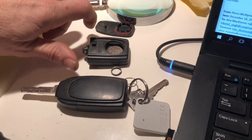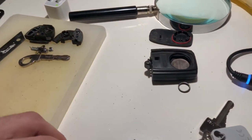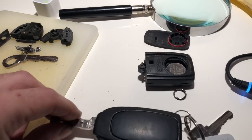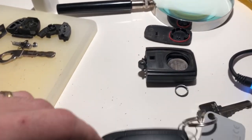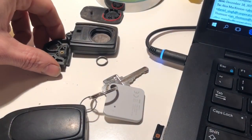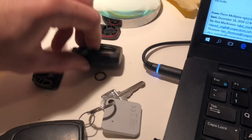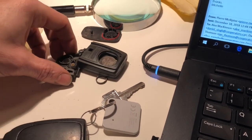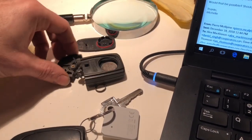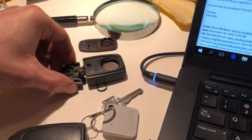Once you've done that, the two pieces slide apart — what I said there is incorrect. The key piece actually slides away from the head of the T9 bolt. That's how you pull the two pieces apart, not left or right. They click back together by sliding the two pieces together, either this way or that way. They don't get pulled apart like this — don't try that. Slide it back together like this.